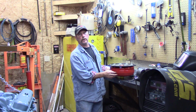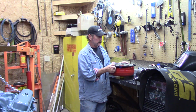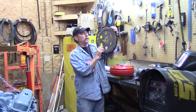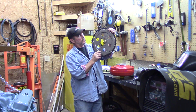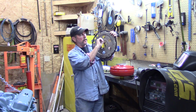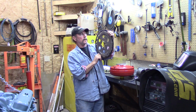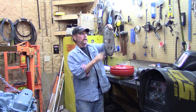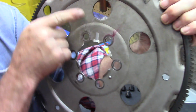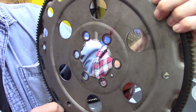And we have a brand new Hughes torque converter, and we put this stock Flexplate on here. And as we took it off, he marked it. And if you ever work on a Pontiac engine, and then all of a sudden you've torn it apart, and then you're putting it back together, you can see that these have flanges that are stamped and they come out, and this faces outward. This is the engine side. So this was marked here, and somebody else had marked it there once before, and you can see this raised area when this is stamped out that's giving a little bit of clearance.